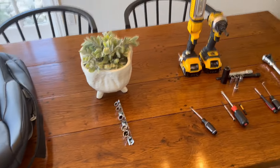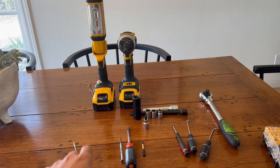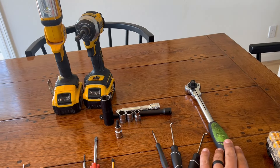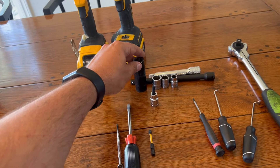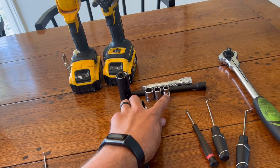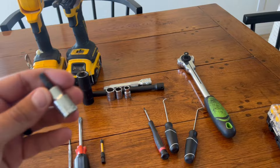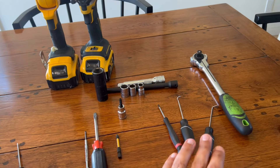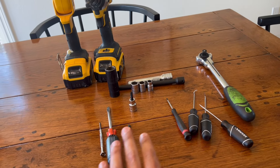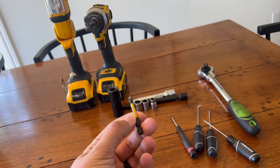For tools we're going to need today: a flashlight, an impact driver — though a simple wrench works too. For sockets you need a deep 18 millimeter, a 15, a 13, and a 10 millimeter, plus a few extensions since there are some gaps. You'll also need T30 torx bits, an assortment of picks — you'll see why later — and a couple of screwdrivers, both flathead and Phillips head.